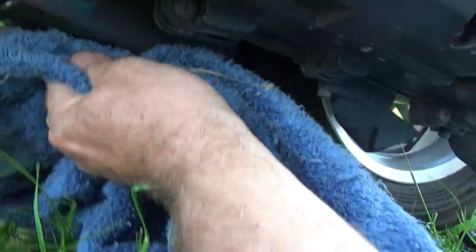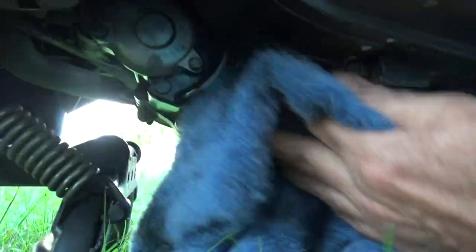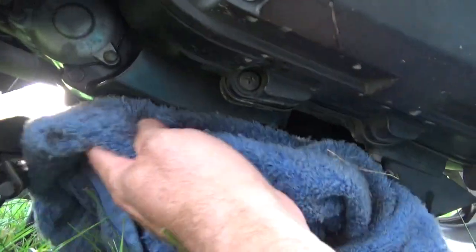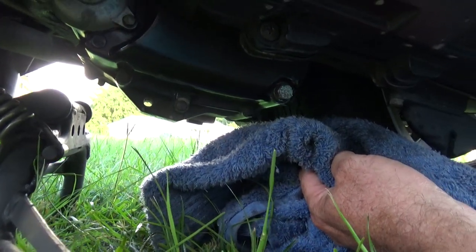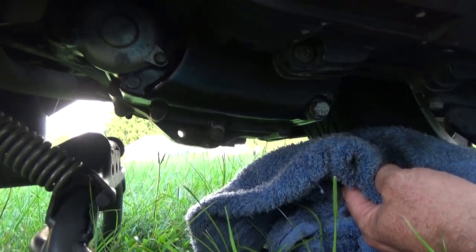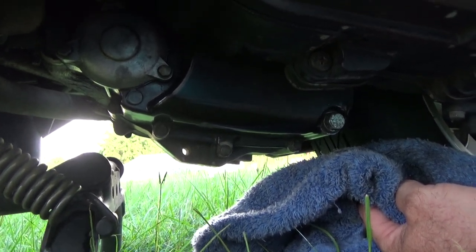Just make sure it doesn't leak. Also, since oil tends to go all over when you drain it, wipe it all down. Because when you're checking for leaks — like you should do — there's no way to tell otherwise. Like I said, no oil pressure gauge at all. No idiot light. No gauge. Nothing. Your engine will totally seize up and you won't know why — the trailer will all be behind you and you're not paying attention. So it's important to look for things like this. This scooter has everything else, including a temperature gauge, but no oil pressure. The most important gauge you can have on any engine is oil pressure, and we don't have one.